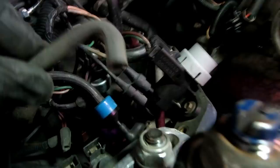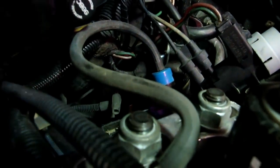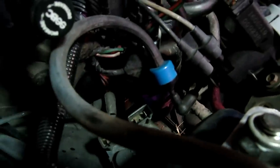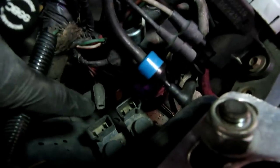That's been done - the T that fed the two solenoids is gone. We'll take the vacuum canister - I don't think it's even needed anymore but just to not create a vacuum leak, we'll connect this to the end of that and complete the circuit. I've got a piece here - it's been teed off and we'll stuff it below here. I'm going to reconnect the solenoids. That leaves no open vacuum lines.